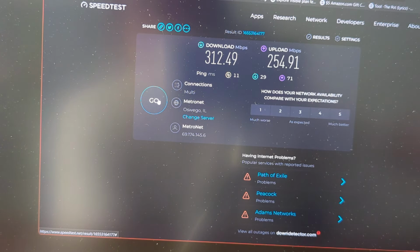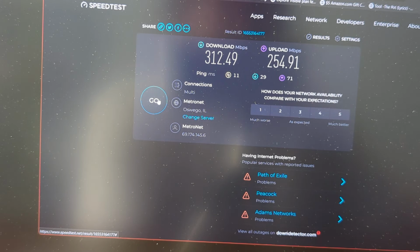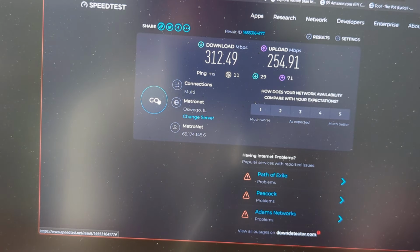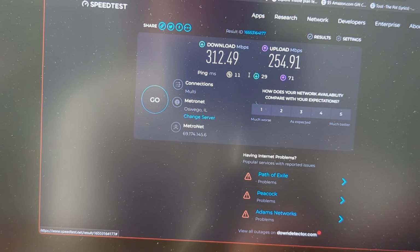I want to have an endpoint, at least one endpoint, that is Wi-Fi 7. And it's not just for the internet. I think that's where I was going, sorry. It's for transfer speeds from my NAS to my endpoints. My NAS is only a gig two, but it's a Synology that has a 10 gig port upgrade path. That's an expensive path, by the way. It's $100 for the NIC. That's what I plan on doing, hoping to upgrade past a gig for my network, and that's pretty much it. My optimism went down as I was making this video in real time, so.